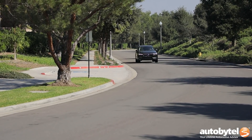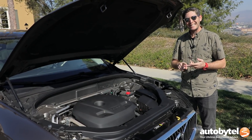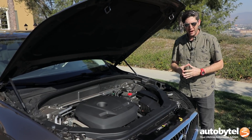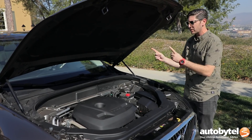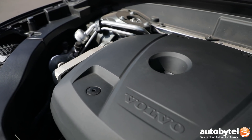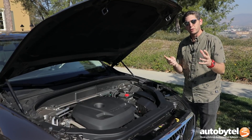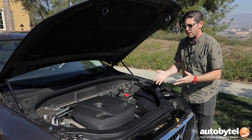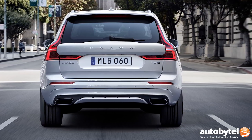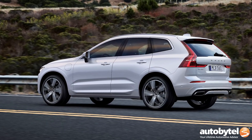When it comes time to pick the Volvo XC60 that you want, you're going to have to make a choice between one of three powertrain options, denoted by T5, T6, and T8. The T5 is the entry-level one — a two-liter turbocharged four-cylinder making 250 horsepower and 258 pound-feet of torque. Step up to the T6, which this one is, and you have the same two-liter turbocharged four-cylinder but with a supercharger added, bringing power to 319 horsepower and 295 pound-feet of torque. The supercharger handles the grunt down low while the turbo is spooling up, then disengages and the turbo takes over. If you want to spend all of your money, you get the T8, a plug-in hybrid with the two-liter turbo supercharged engine and an electric motor on the rear axle, combined producing 400 horsepower and 472 pound-feet of torque. All of them are backed up by an eight-speed gearbox.